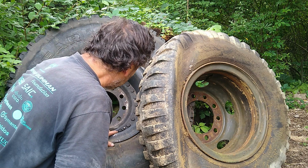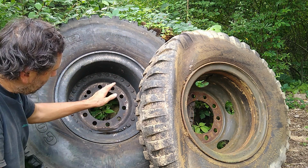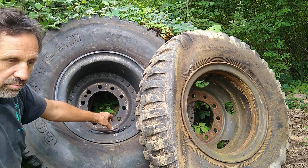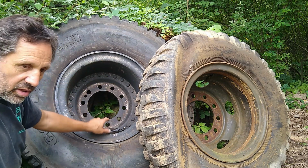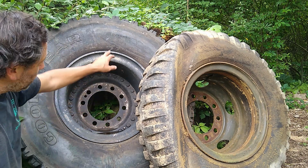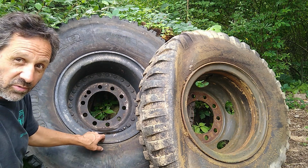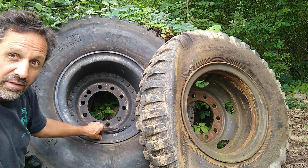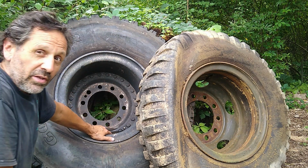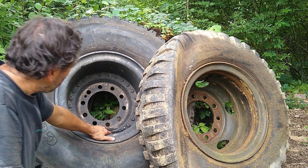Now the other option, which I'm considering also, is going back there. It's an 8-hour round trip, and exchanging these aluminum wheels for steel wheels, which he has. The steel wheels, being thinner, might have the extra clearance, but I probably would have to confirm that before I made that trip. Because I don't know if the super single wheels, the inside diameter of the steel ones, should be, because frankly, the tire itself is 20 inches regardless. So if you have a thinner steel wall there, probably I'm going to have the clearance. So the fact that these are aluminum wheels is probably my problem. I don't know where to go from here.